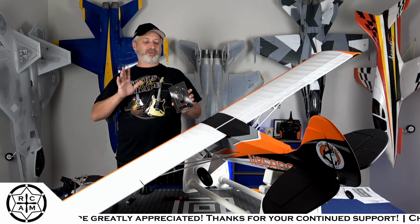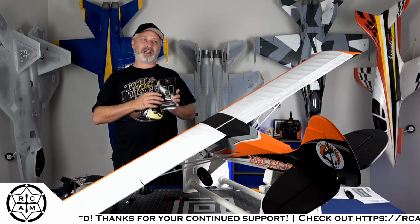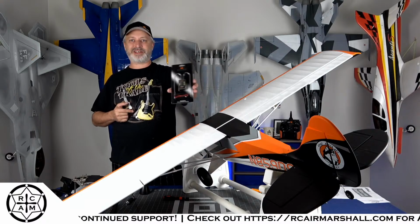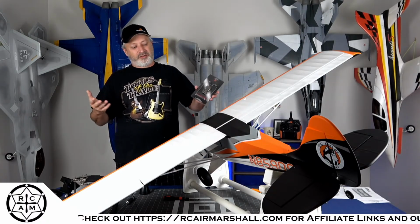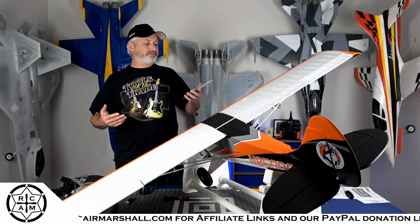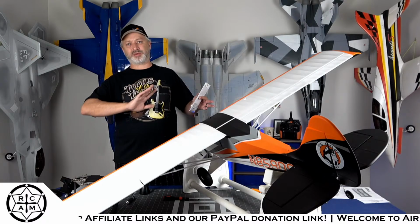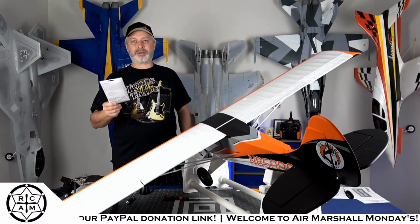The reason that I went with 8 channels, even though I don't need it when I'm using non-gyro enabled receivers, is that this thing is only $10 more than the 6 channel. If I put the 8 channel in here now, I'm going to be using 6 of those channels to control all the functions of the airplane as well as the flight mode change, and the other 2 outputs are going to be freed up.